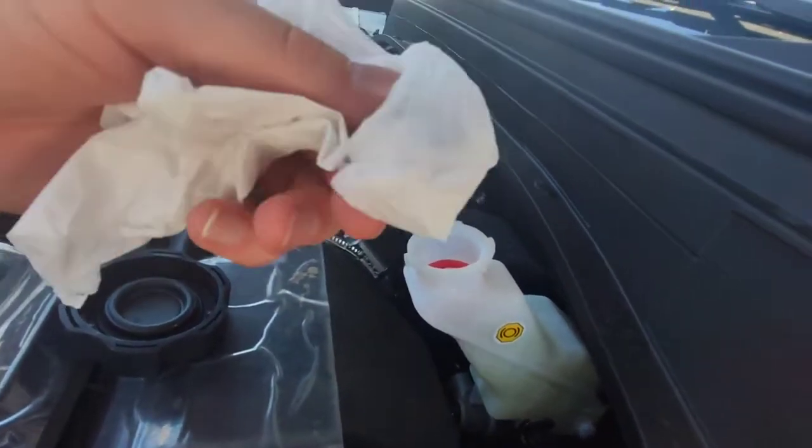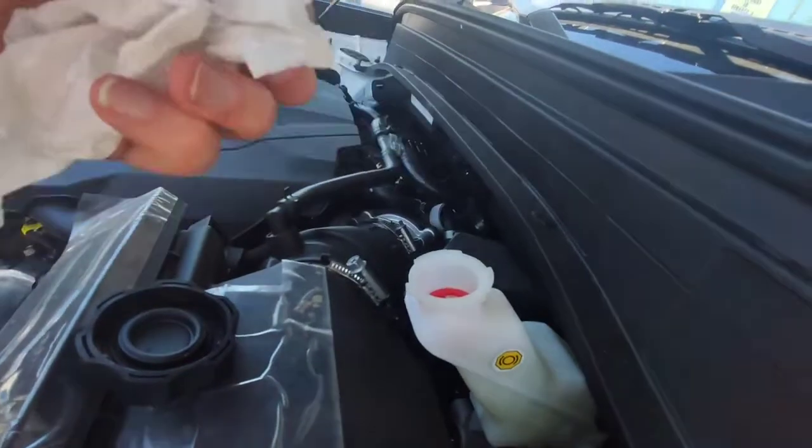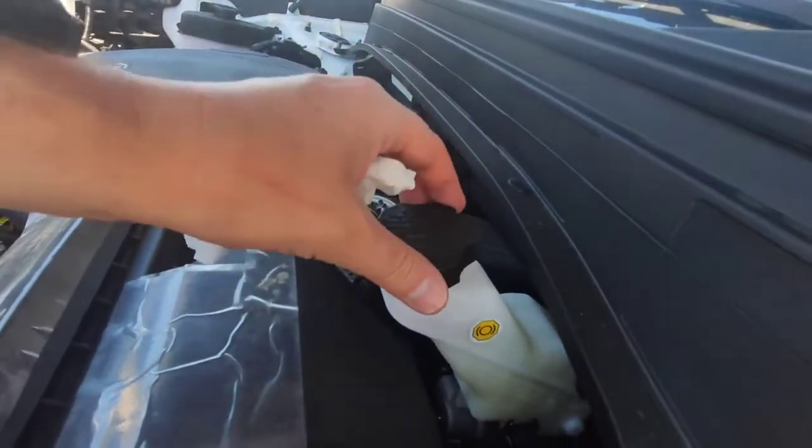You'll notice there's no color change in the tissue — it's still nice and clear. If it's gotten too yellow, that means we need a brake fluid flush. Basically, what you're looking for is anything you would consider yellow. If it's just off-white or slightly yellowing, you're probably fine. If it's actual full-on yellow, you've got problems — anything past a light lemonade color you should be concerned about and maybe get it checked out. If it's clear, obviously you're fine; make sure the level is good and you're good to go.